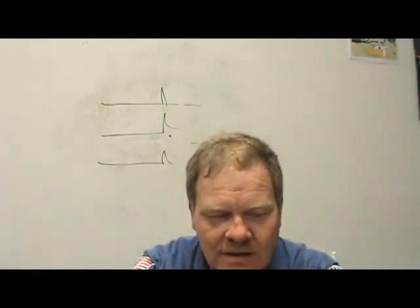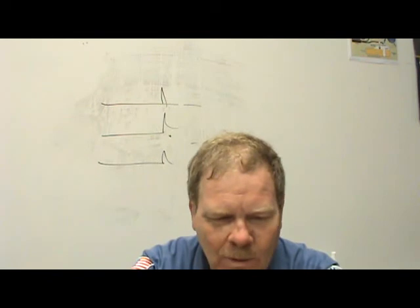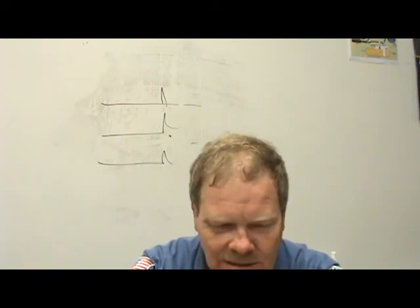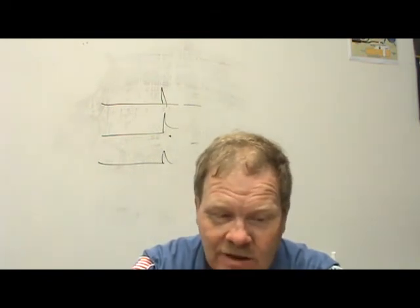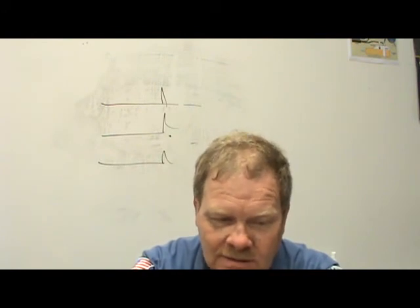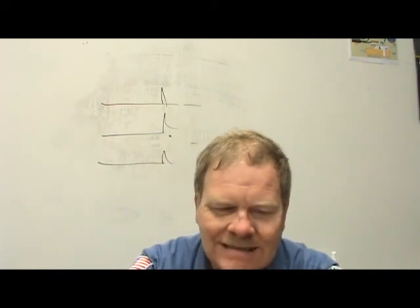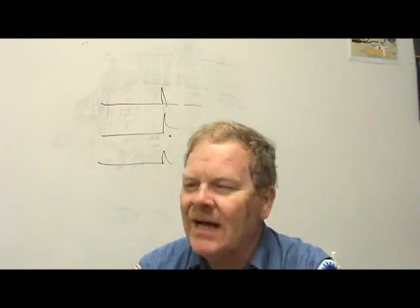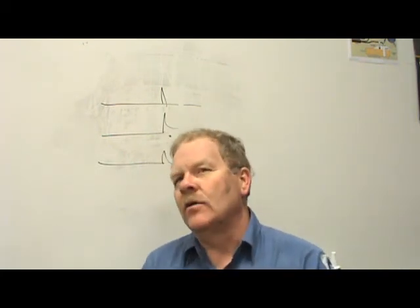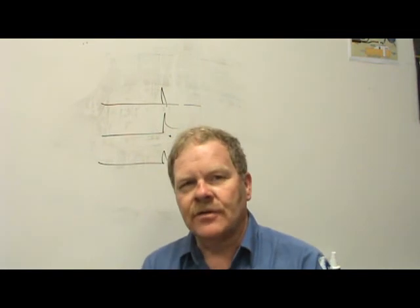Okay, number 15, superior coil saturation time is found on coil on plug ignition systems. Why is this? A, a coil only needs to fire once per 2 engine revolutions. B, no spark plug wire exists. C, dwell on these coils cannot be controlled. Or D, platinum spark plugs allow the coil to build up a stronger magnetic field. That's actually A.